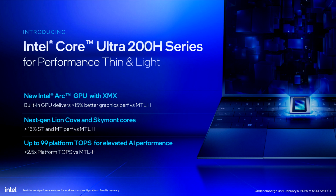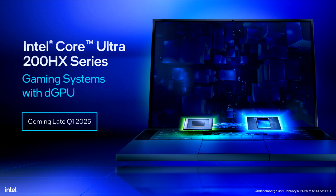Lastly, the 4 Intel Core Ultra 200U parts feature the same configuration across all the SKUs. These include the Core Ultra 7 265U, 255U, and the Core Ultra 5 235U and 225U. They offer 12 cores, 2 plus 8 plus 2, 14 threads, 12 MB cache, up to 5.3 GHz clocks with 2 PCIe Gen 4 lanes, 4 TB 4.0 ports, and up to Wi-Fi 7 support. All 4 chips have the same 15 watts base and 57 watts MTP ratings.